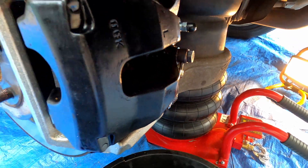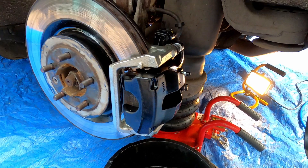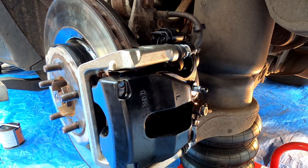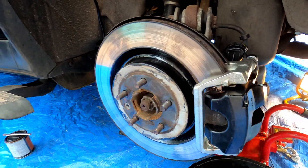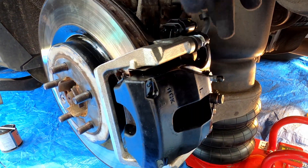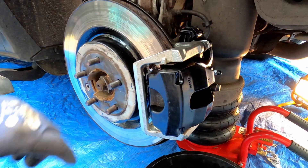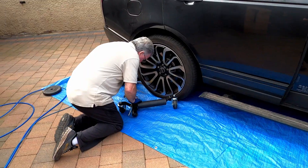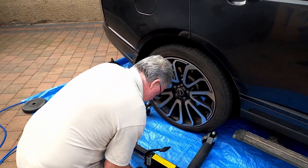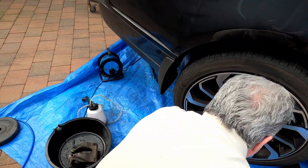We've got it all on and we're just about to test it. So Pat's going to put the handbrake on - put it off and on again. That's working fine. We had a bit of a problem - it seemed to be out of sync. So we took the caliper off, wound the piston right back, made sure it was on, put it back on again - it worked fine. So one down, one to go. That's us done the near side rear. Moving on to the off side rear, where this caliper is functioning properly.